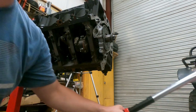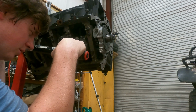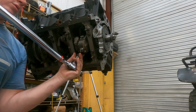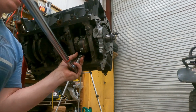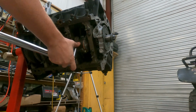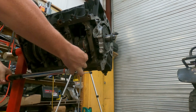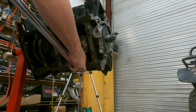Grab a torque wrench. And we're going to set her at 15. She's actually preset at 15. So now we'll torque it at 15. And then 85 degrees. This is a second generation rod, so almost 90. 85 degrees. Rod's torqued. All right, well, now I'll bring you back for the next part.